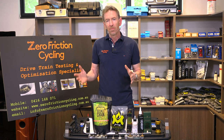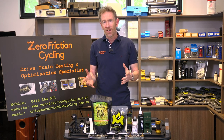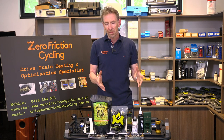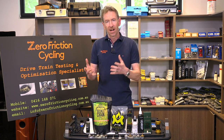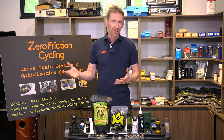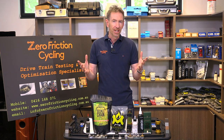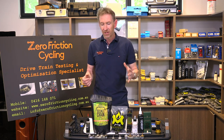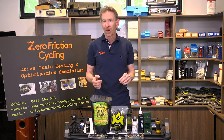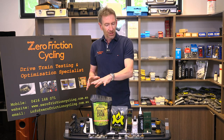Those are the top main lubricant choice. Then there's immersive waxing — I'm going to expand on it a lot more in a future video because it's a deep topic and can be a little bit divisive. Basically, you melt a wax down in a pot, put your chain in a bath of wax, and it comes out coated in a super slippery solid coating. Things are magnificent if you've got a top quality wax.